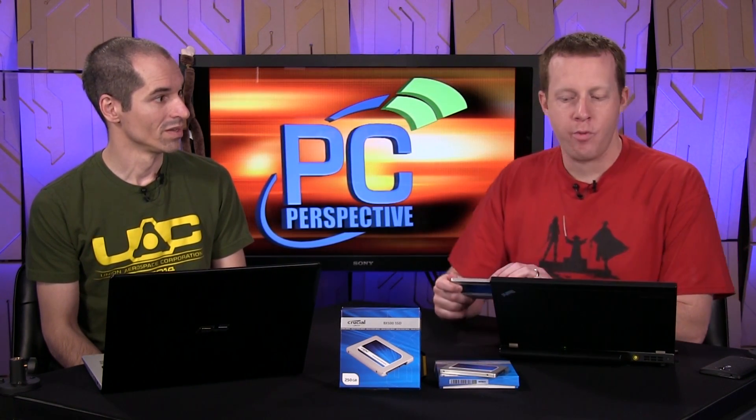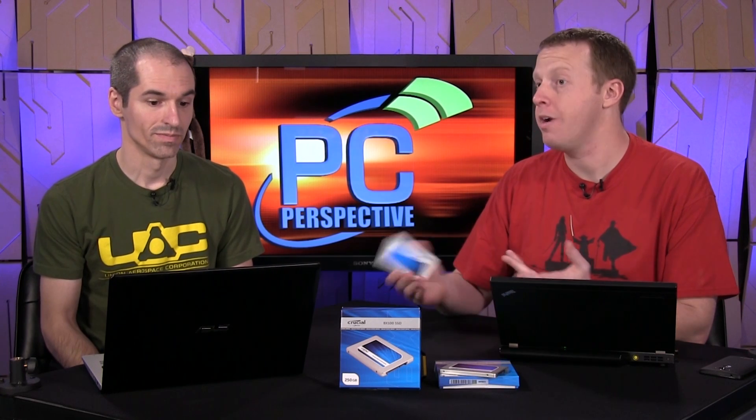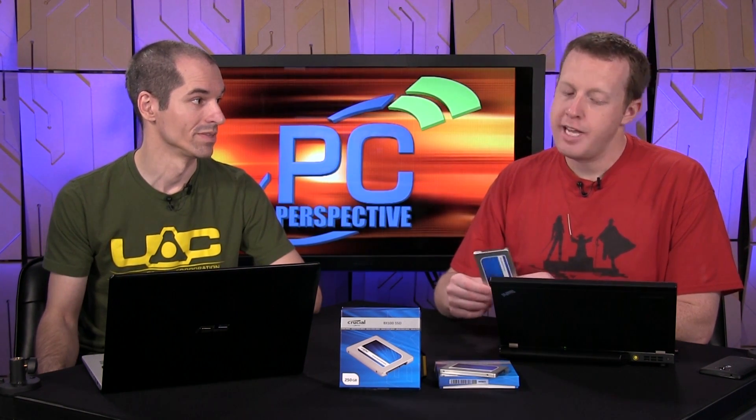Here's the thing — I would say don't get the 1 terabyte. If you're really looking for 1 terabyte and you have a desktop PC that can fit more than one SSD, buy a pair of 500 GBs because you'll save yourself $20 and the performance will be roughly double if you RAID 0 them. So you can get a 1 terabyte for $360 at RAID 0 performance levels, dramatically increasing your read and write speeds. And since that 500 GB model is just a little bit cheaper than the 1 terabyte model, it doesn't look like going four 250s is the right way either — but hey, you could do four-way RAID 0.